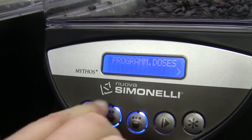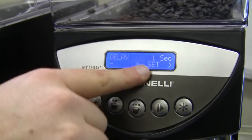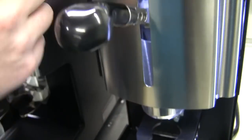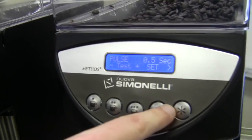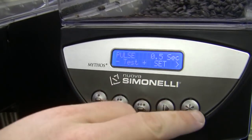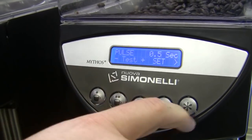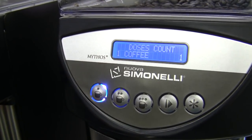Let me try that again — got to get out of continuous mode. As we go through: we have what's called a delay. That one-second delay is from the time I hit this button. So as I take my portafilter and push it in, I want to delay just to prevent accidentally activating it — you've got to be committed and hold it for a second. Next is a pulse setting — if we're in barista mode, I can hit this button and pulse it for 0.5 seconds, just a little extra up-dose.